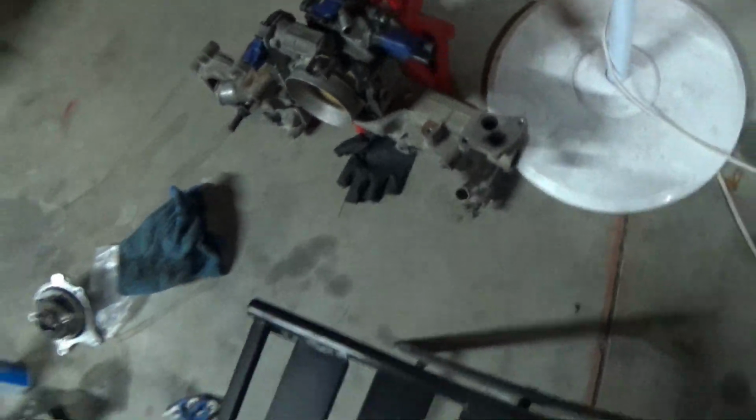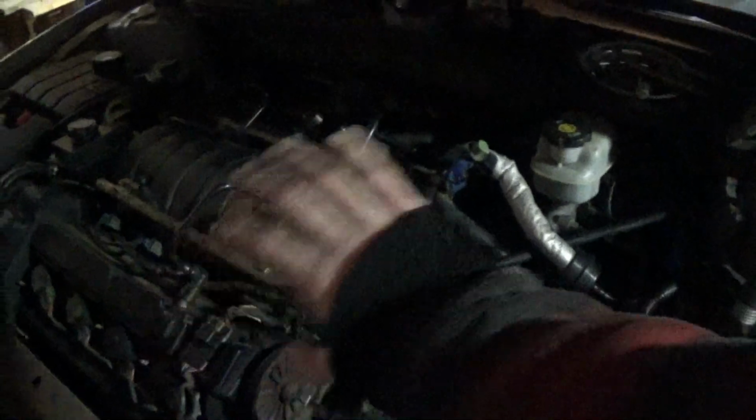That was so dumb. So originally today I was going to try to figure out what made the ASD fuse blow, and it actually was perfect timing because I just ordered a fuel pressure test gauge, and I was originally going to use it on this car and just keep it around for the future. As you guys know, we have the coolant crossover out right here. That was one heck of a job to get it out, and I just removed the fuel rail, but I didn't actually completely remove it. I wanted to use the test gauge to make sure the system is depressurized, then completely remove the fuel rail and a couple other lines to make it a little easier to go back in. That's the reason I ordered it.